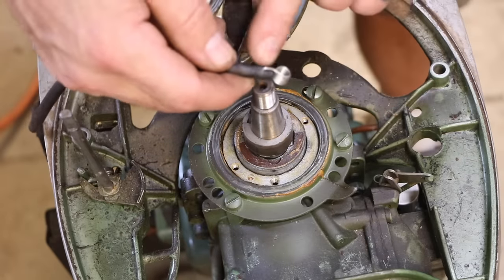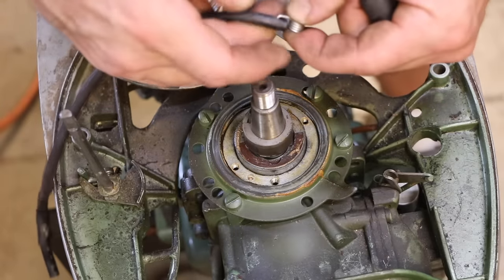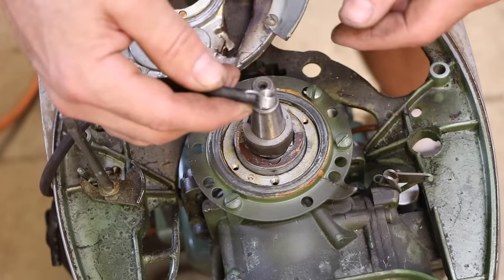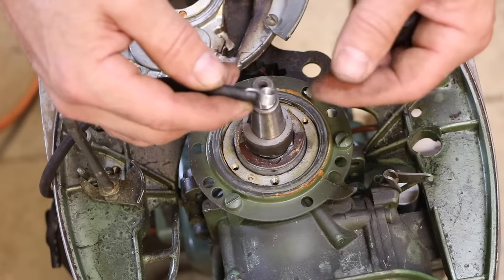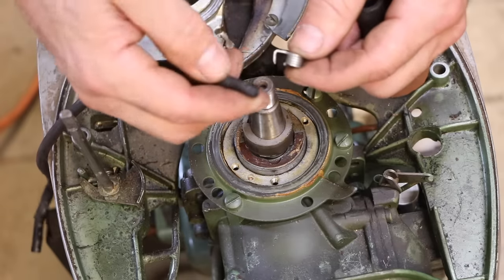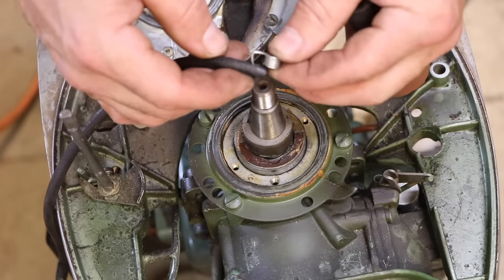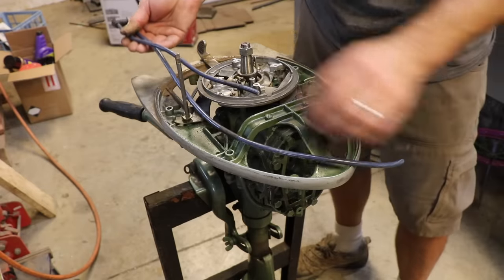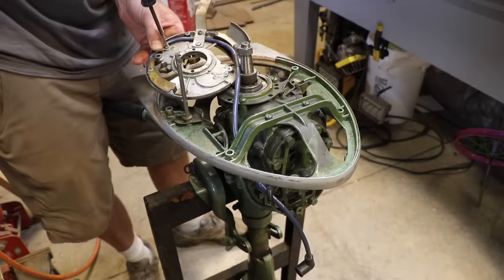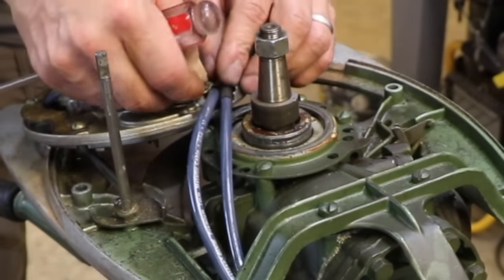Cut the boot off — this is how it connects to the wire, there's just a needle and a spring. This is what clips onto the plug. The failure point is that needle penetrating into the wire — it's probably arced to the point that the connection is no good. I had to get a universal set of spark plug wires, and they didn't have a connection that's so low-profile like this, so I am reusing the original ends. They worked for a long time and can work for a long time more. I put some heat shrink where these are going to get pinched and held in place.